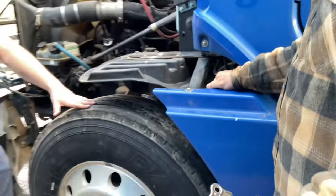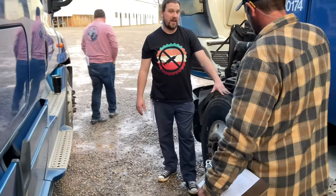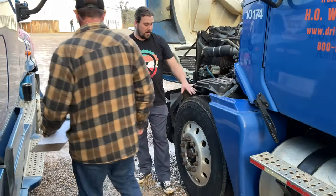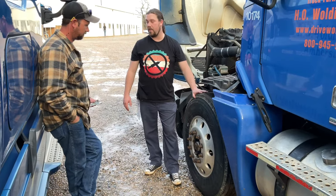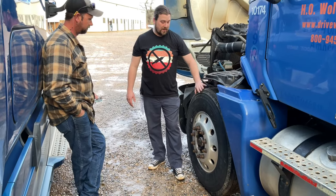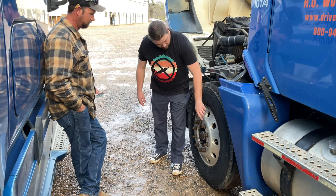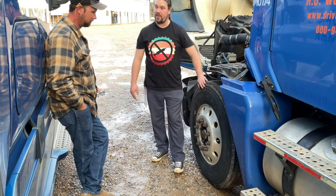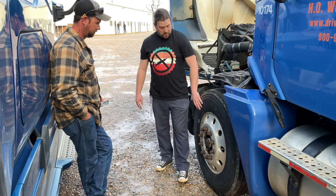On my wheels. On the front of the truck, my tires have to have at least 4/32 inch tread depth. They cannot be regrooved, recapped, or retread. They must be virgin rubber. Must be 90 to 100 PSI, checked with an air gauge, and have a metal cap on the end of the valve stem. They cannot have inside or out any cuts, bruises, or blisters.